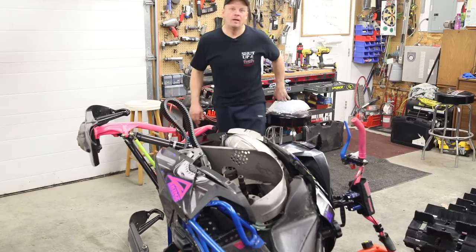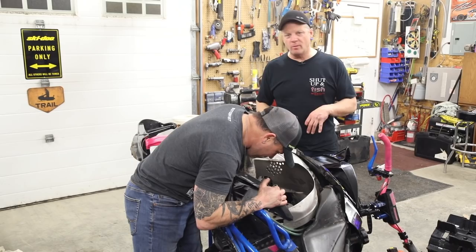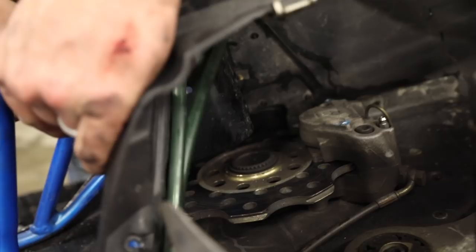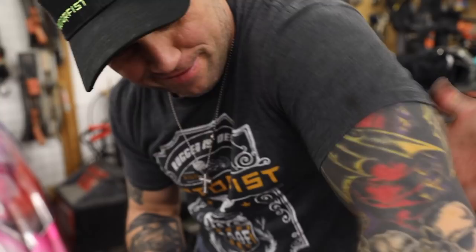Step 43: take your secondary off and then you're going to have to loosen that plastic up. We got all these carbon fiber parts from Patrick's — we're putting it on this sled. Skins has joined us for this exciting experiment. So we need to take the snap ring off the brake disc — the brake disc can only come off from the three bolts that hold this whole assembly on underneath. Reach underneath with your hand and feel three or four little ten millimeter head bolts — those have to come off.